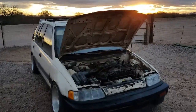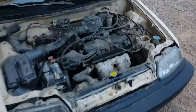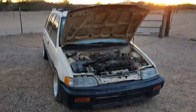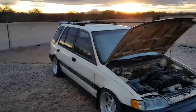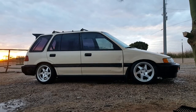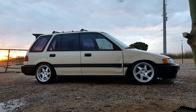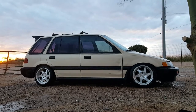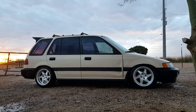It's all back together now. Just make sure you fill your radiator back up, then let your car idle for a couple minutes and check it again. I'm gonna wash this thing. It's all cleaned up, thermostat's in. Check the fluids again — topped them off. I'm gonna drive her to work tomorrow and hopefully it shouldn't run hot anymore. Keep you guys updated.